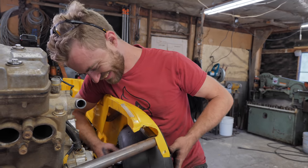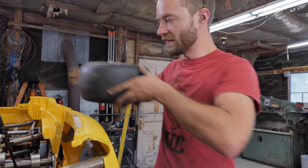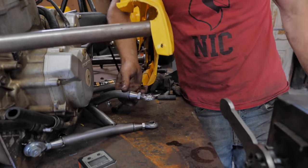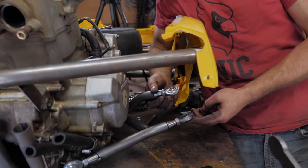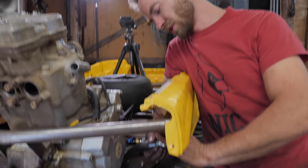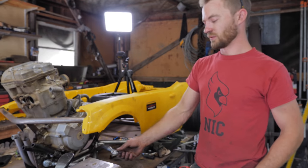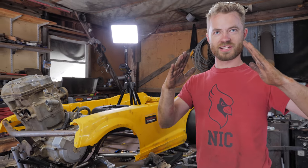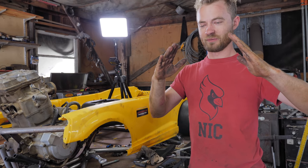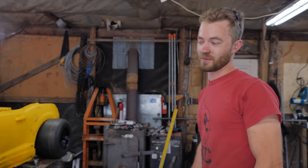It'll be easier to show what's going on as it travels. The camber changes directly with the travel — at full compression it's cambered closer to vertical. What that means is we can have it set to an excessive amount of camber when it's at full drop so that it looks ridiculous, and then when we air it up a little bit to drive it, it'll be a more reasonable amount of camber. You put that together pretty quick, but now it's time for the hard part — replicating it on the other side.